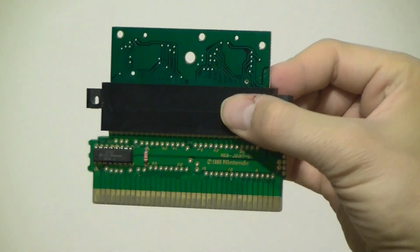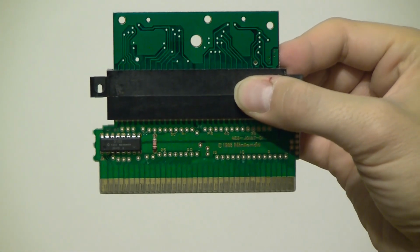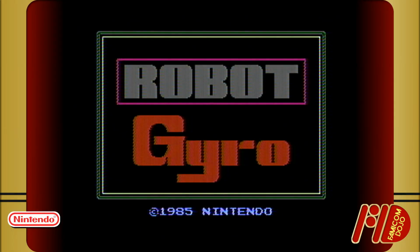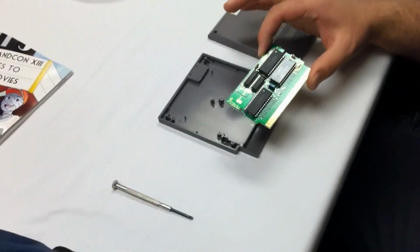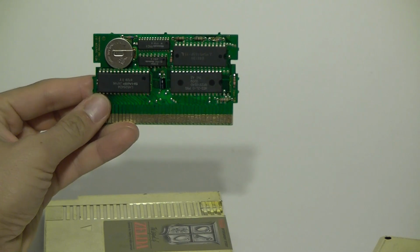Because of differences in the cartridge pin outputs, and the need to house a 10NES lockout chip, a converter cartridge was required to make these Famicom games playable on an NES. This also explains why some games, such as Gyromite, had their title screens unchanged from the Japanese versions. Similarly, Nintendo-published games originally released for the Famicom Disk System all used the same board on the NES, reserving a spot for the battery backup to be used when the technology was cost-effective enough to include.